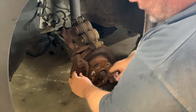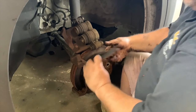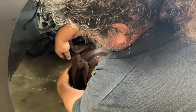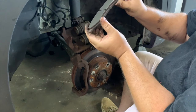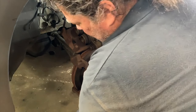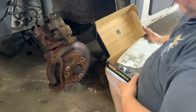Your pads are retained here by metal clips, which will come with the new pads. You can see that this one is quite shot — I'm rather glad I took this apart. The pad on the other side was about two-thirds worn. They're supposed to wear evenly, but if they don't, it's not the end of the world. And because we lubed those slides, this rotor is as smooth as a baby's butt.